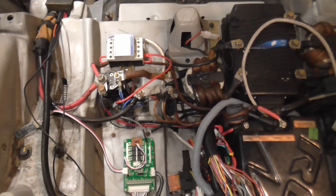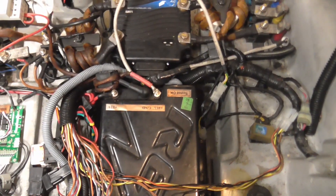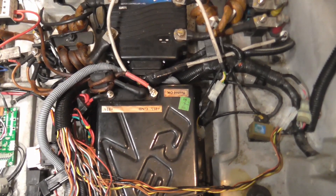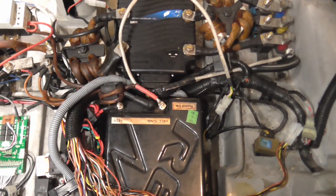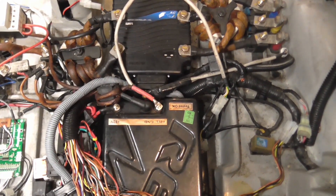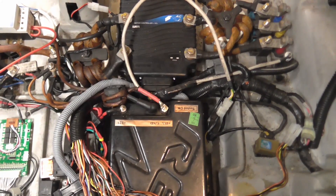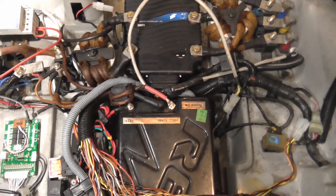Another notable modification is the way the 12-volt system works in these vehicles. This unit here is the battery charger — you've got plus 48, ground, and 12-volt. It's not only the battery charger; it is also the DC-to-DC converter that provides 12 volts for all the normal 12-volt electrics — lighting, indicators, and so on. That 48-volt terminal is both an output when charging and an input when driving, and it is normally permanently connected to the battery. So it's always drawing a bit of current from the battery and always outputting 12 volts. If you leave the vehicle standing for any length of time, it runs the battery down.